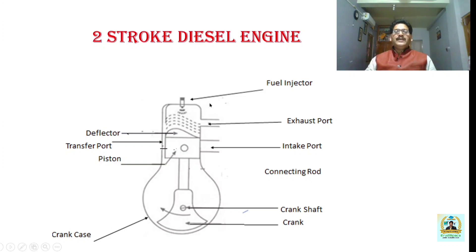There is no carburetor arrangement in the compression ignition engine because the air-fuel mixture is not pre-prepared. This is because the fuel used in the compression ignition engine is diesel, which is less volatile compared to petrol. No carburetor would thoroughly mix diesel with air, so the carburetor is not an integral part of the compression ignition engine.